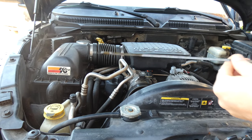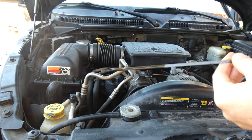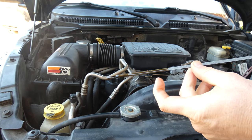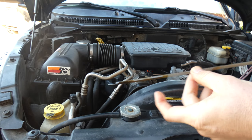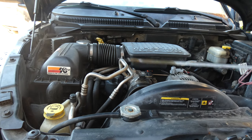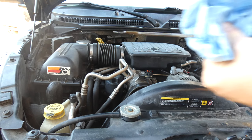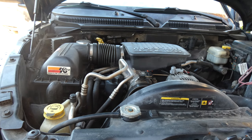Now you're going to pull it out and this is where you read it. In this case, you'll see there's actually so much oil on this dipstick that it's above the safe level — it's over the crosshatches into the writing that says to check while the vehicle is level. This engine does in fact have too much oil in it, which I will be correcting shortly. But I'm using this to illustrate a valid point — a way that you can get swindled.